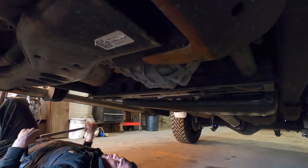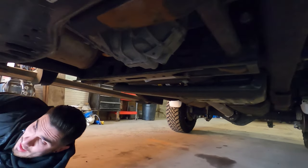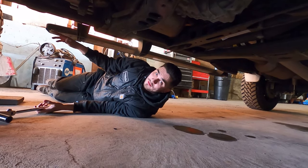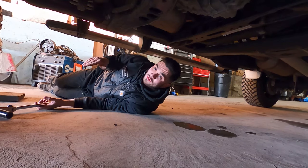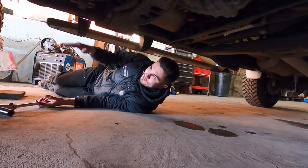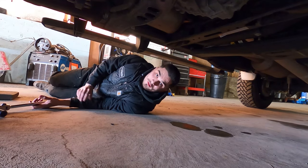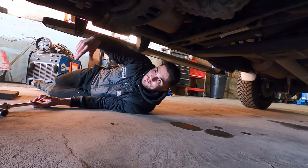These keys are almost backed all the way off, which is fine. Now after you do this, lower the truck — but you're not done, because it's gonna look about the same right after. The suspension is not settled. You've gotta roll forward and back; usually I roll forward, hit the brakes hard, roll back, hit the brakes hard — a couple times. Let the suspension settle and put weight on it, then check it. If you check right after, it'll probably be no different.